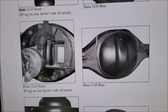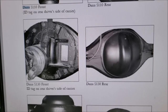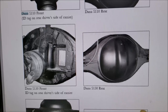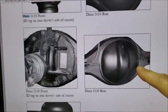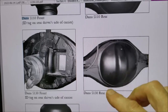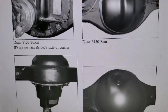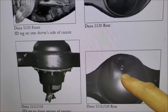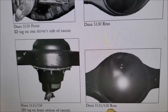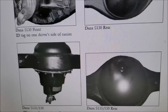Here's another quick tip I'm adding to the end of the video. If you're curious whether you have a W24 or a W22, one quick way to find out is to look underneath at the differential. If you look at the rear of the differential and there is no check plug, that is a Dana S130, which means you have the heavier W24 chassis. If you see a fill/check plug right in the middle, that means you have a Dana S135 or Dana S150, which means you have the lighter W22 chassis.